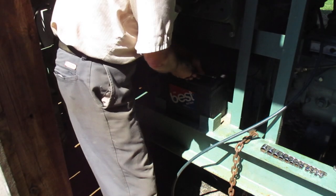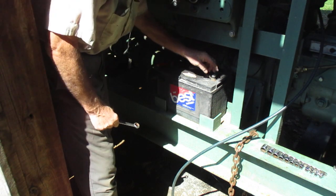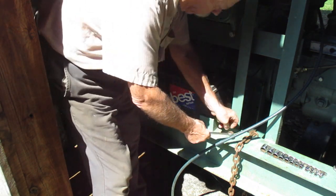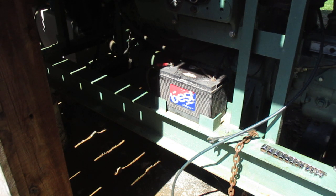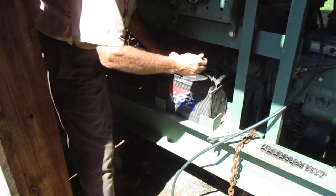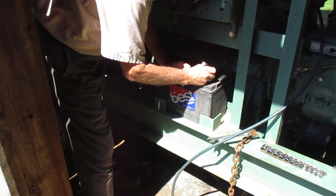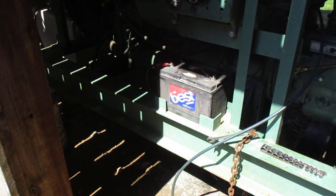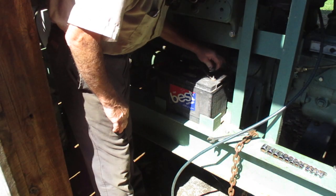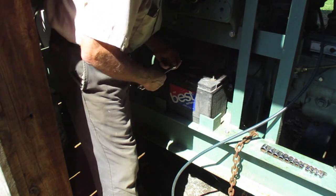Let's see... yeah, well, we'll start with taking the battery apart. I have two ground wires which I'll mark. I generally like to take the ground ones off first. Can't find my marker. I'll forget which goes where. These are marked real good with red so I'll just put some black on them, just because I don't feel like getting it messed up when I put it back together. I generally like to take the ground ones off first because if you're swinging with a wrench and you hit the frame, you're not going to spark.